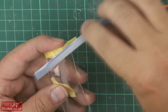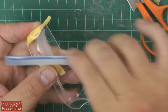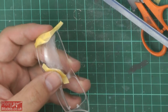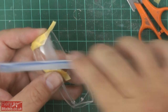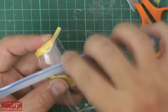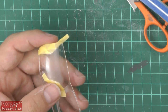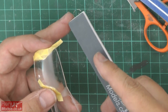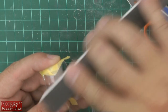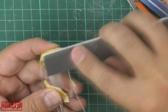We've got it all off, looking very even right the way across. Then we grab some sponges — a little skinny sponge — and this is taking out that original scratching. You want it all to look the same as we go through. The reason for using a skinny one is just so we can keep it localised and see what we're doing. I can look for it. You're looking to take out just the biggest scratches. You're not trying to polish it up at the moment. Now we're going to work our way through the different sponges — this black range is a plastic sander on one side and a polisher on the other.